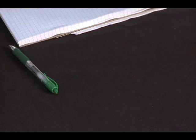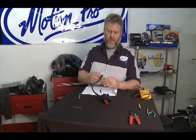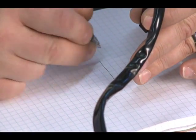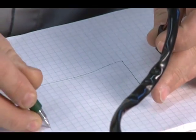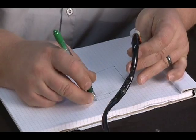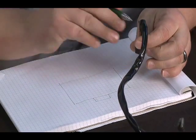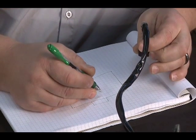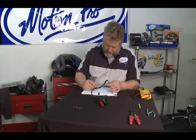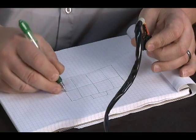The first step is always to determine the position of the wires in the stock switch and to determine what those wires do. It's always easiest to make a drawing from the back side of the switch. I use the little clip as an indicator of position. We have eight wires — seven wires and one empty spot.